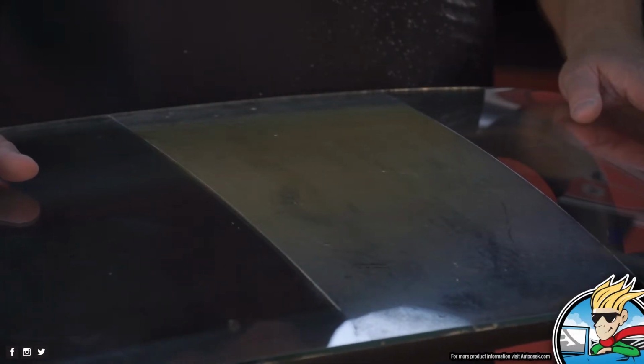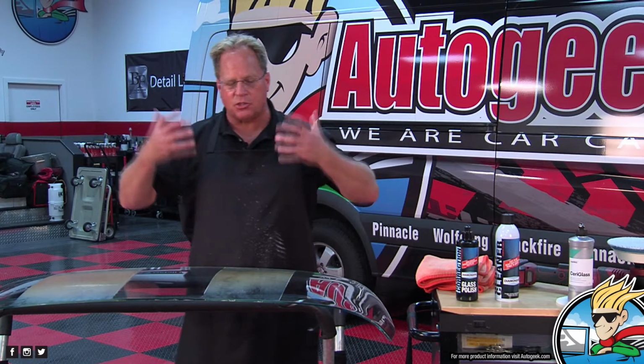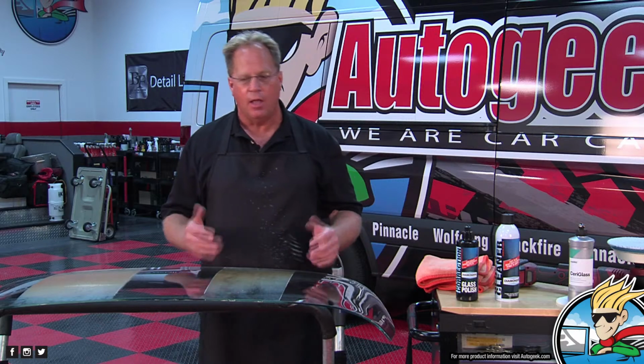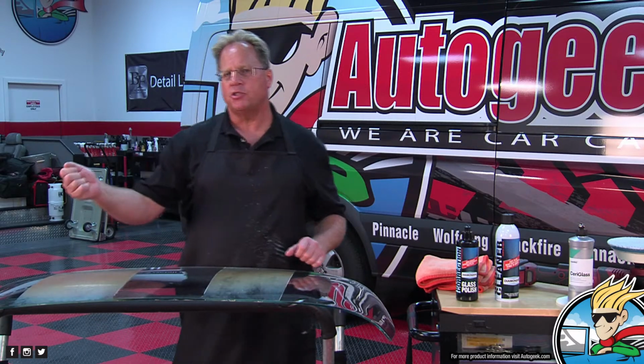It's pretty bad. That's why I wanted to show this, because it's the extreme example teaching you that your glass has a film on it. And it's also something you can do. We've done this in a video. If you're a detailer or even an enthusiast detailer and you're going to detail your car, at some point go out and machine polish just one window or one half of the windshield, and then spray water on it and see what happens to the glass that you machine polished and the glass that you didn't.